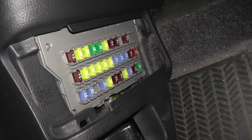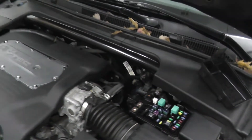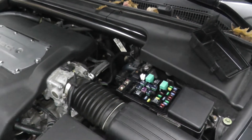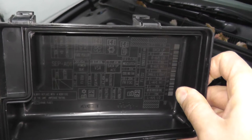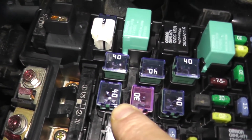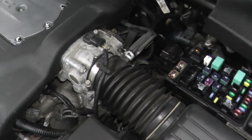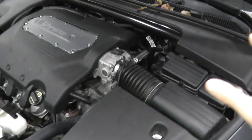There's one other fuse you can check. Back at the under-hood fuse box, there's a fuse for the ECU — the vehicle's computer. Number 19 is the ECU fuse — it's a 40-amp fuse. If this fuse is blown, you'd have trouble codes for the air fuel sensor as well as a number of other sensors, and chances are the car won't even run. But it's still a good idea to check, especially if the vehicle was in a collision or there was a flood — always a good idea to backtrack everything.